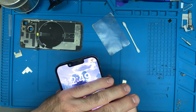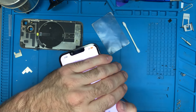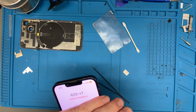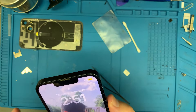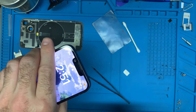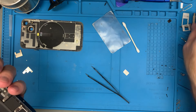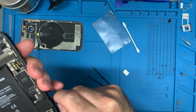Let's try this again with my own personal SIM card. Immediately it came up on the spot doing what it's supposed to be doing. I just put the customer's card back in — look, it just came up. What's going on? Why is it working now when it wasn't working before? I had a theory that I mentioned to the customer: because of the water that got in, there was a possibility that there was a little bit of liquid that came into that SIM tray. Just putting it in and out as I did may have been enough to clean some of the corrosion off those pins. As I said, this is a theory.